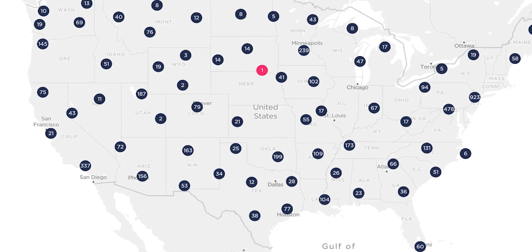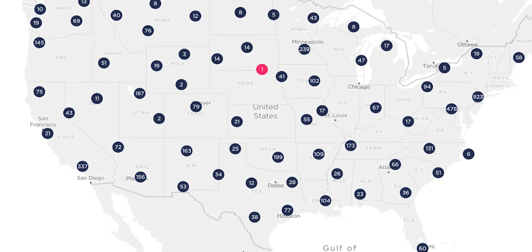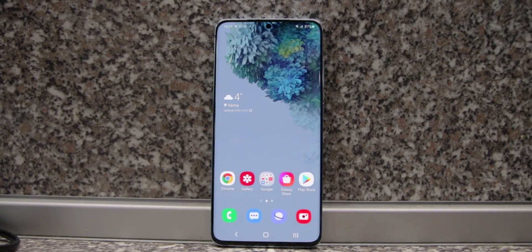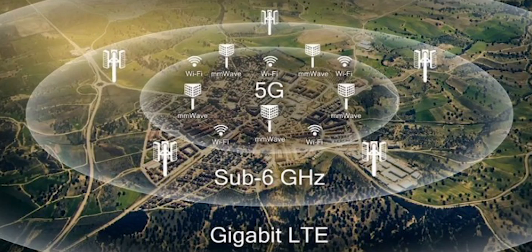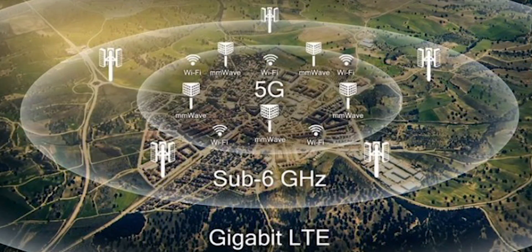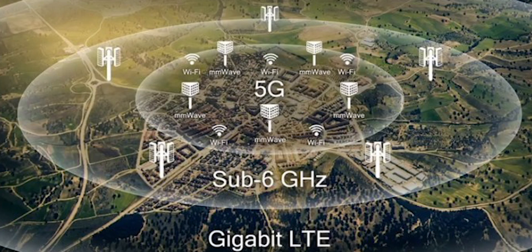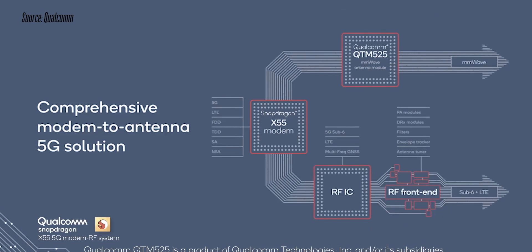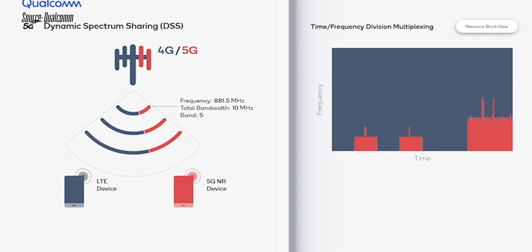Let's also say a few words about 5G. All three S20 phones have 5G support in markets where there is a 5G network, but the smaller S20 is the only one that doesn't support millimeter wave — the type of 5G only available in individual small spots but with super-fast speeds. We don't think that's something you will miss, but you should know about it. All three phones support the more widespread sub-6GHz type of 5G, which uses frequencies below the 6 gigahertz range.